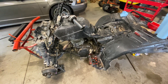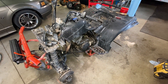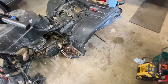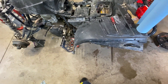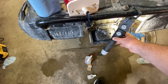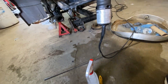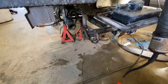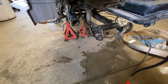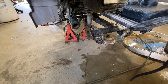It's NLP Sled Head here. I've got a project that was gifted to me by some good friends. We thought initially it had a bad universal joint up front, but no — it was way worse than that. This light on seems to be a common problem. This is a Yamaha 250, 1995 Timberwolf, and yes, the axle was completely shot — the differential was full of mud, it rusted, and the bearings fell apart.